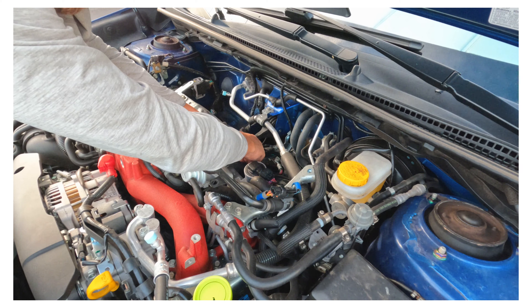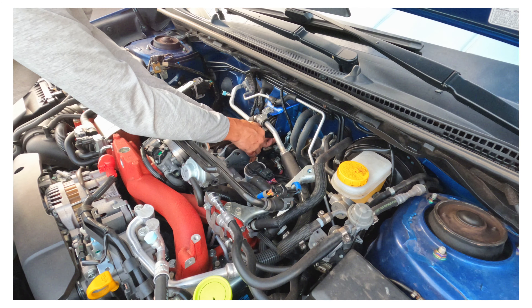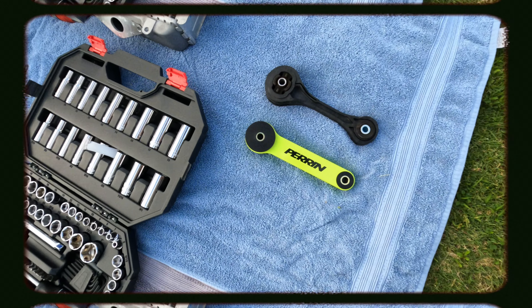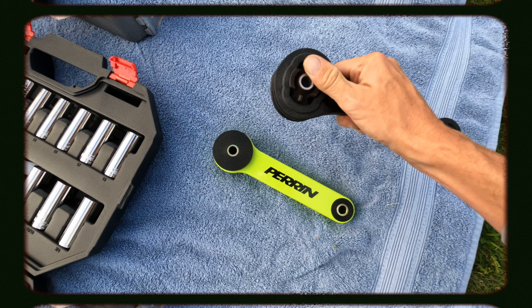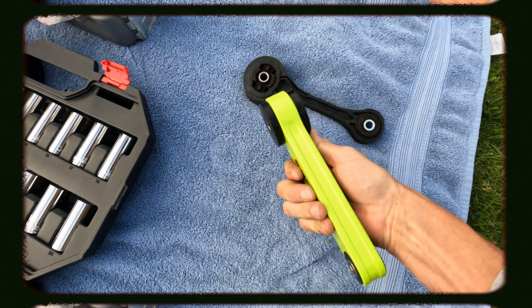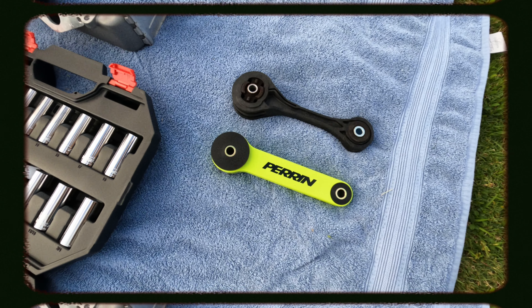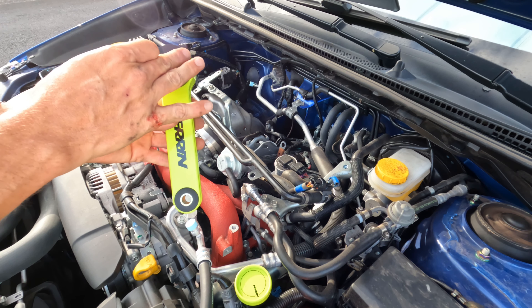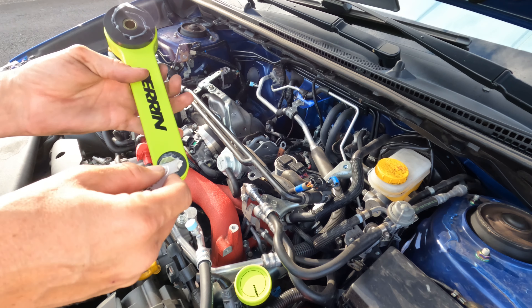You want to be careful removing these bolts because you don't want to drop any of the hardware — there are two flat washers you don't want to lose. And there you have it. As you can see, there's a major difference. The stock one is like plastic and flimsy with little rubber bits, but this Perrin thing is a beast — super thick. It just doesn't even compare. It's gonna take a lot of the vibration out of shifting. Next step: take your new pitch stop mount, apply the lube that Perrin supplies, and put it around all the bushings so it can slide in there.